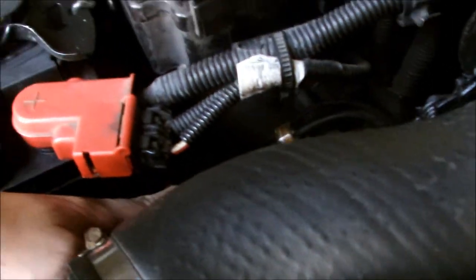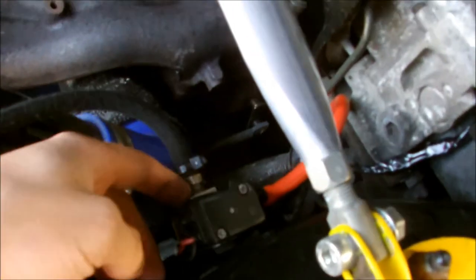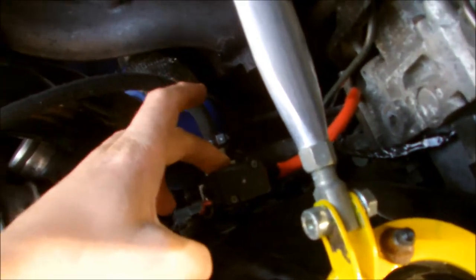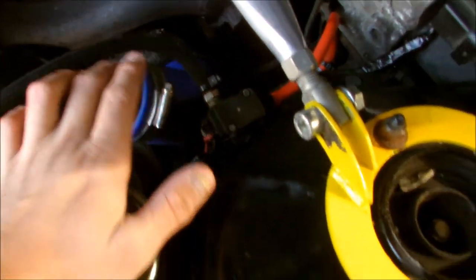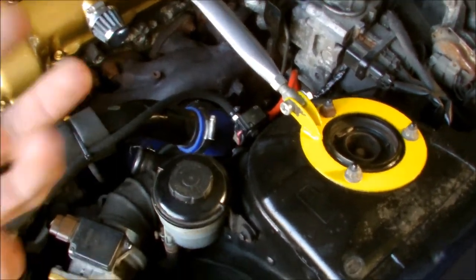Over here, just down there, right in here - you can see it there. That is the boost sensor unit, that reads boost pressure and sends it back to the control unit. You'll get two wires coming out - positive and negative. It's just a normal solenoid valve. The T going into your normally open is from boost reference. This pipe is from your boost source, so it's reading straight from the boost source into your normally open. Then this pipe here is going down to my wastegate. This is what controls your wastegate opening. So if you set your PSI above, say, 12, it will not send positive pressure to the wastegate, so your wastegate will stay closed, hence keeping you at 12 PSI at the turbo.